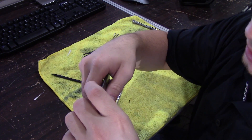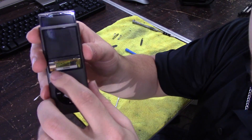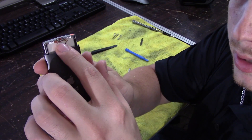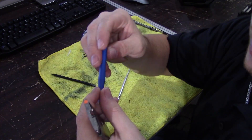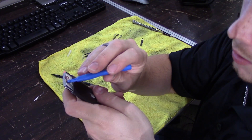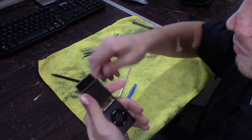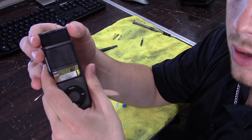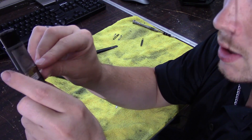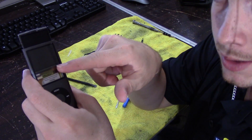There's a cable that's attached to the lock switch and those break extremely easily. You just pull it part way up and you can start to see that cable. First thing you want to do is the switch is adhered on, so just take your plastic tool and slightly pry up on it until it comes out. I got it off. Then you want to pull this screen just enough — you don't want to yank it out because you're going to break that cable. You want about a half-inch gap between the bottom of the glass and the screen.